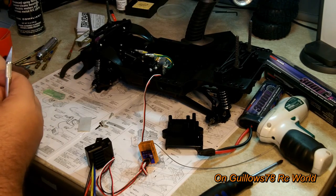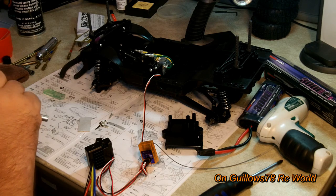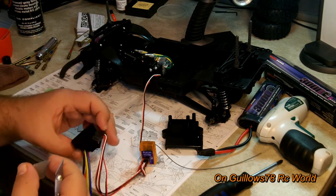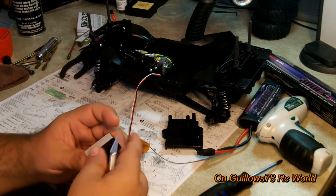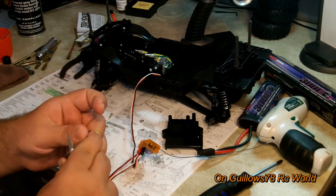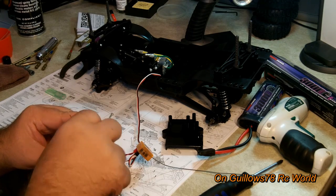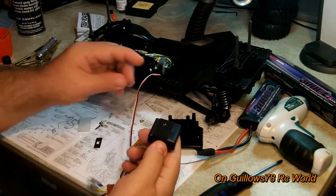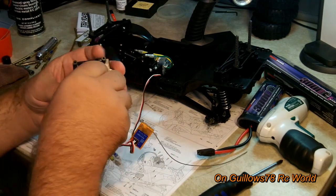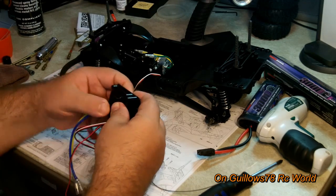Now, take our X-Acto knife here. We will peel off our layer of tape that holds the sticky tape into place. Peel that off. Stick one at the bottom of our ESC, sorry. Rub that in pretty good. Then we'll make our next layer out. Knife down, and then always, like I said, make sure with this one here, it's going to sit this way of the truck on these top posts, so give it a good snug push down there.